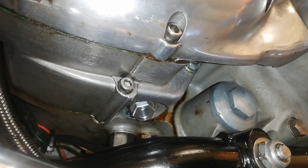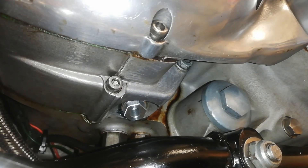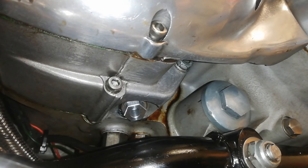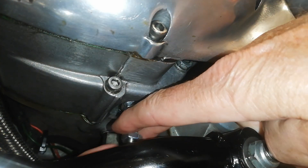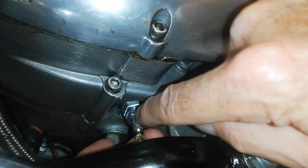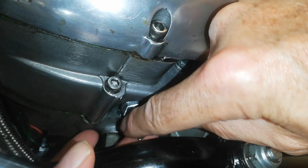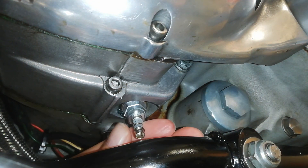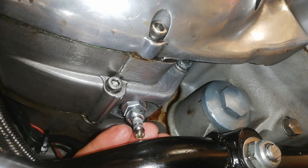All I'm going to do now is grease the tip of the sensor slightly, because I don't want to damage the little oil seal inside the adapter. Obviously the last thing you want to do is damage the oil seal as it slides up. I've got the sensor and it should just go up inside here, hopefully missing the frame. There's a lock nut on the end - you should screw it up until it just hits the neutral lug.